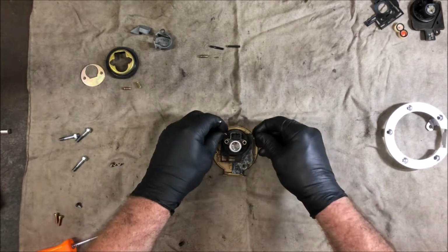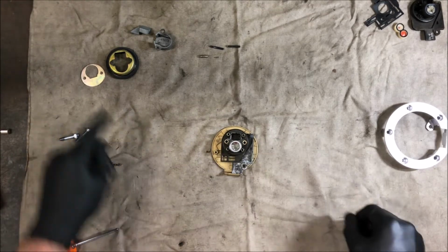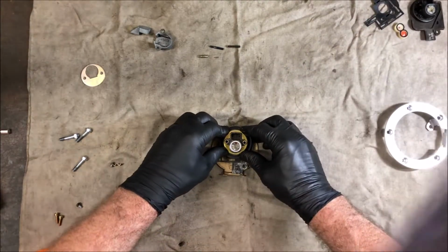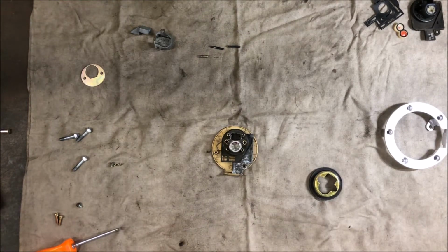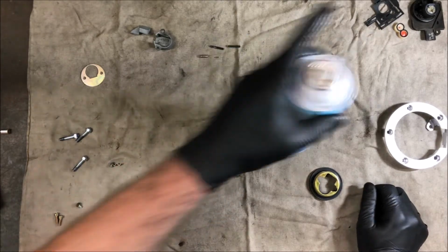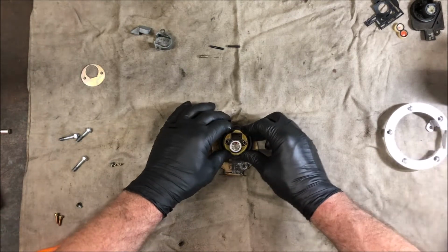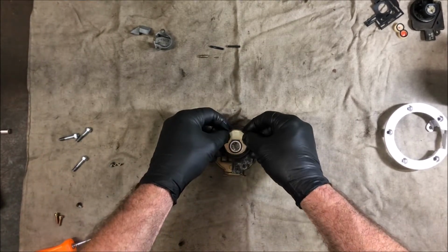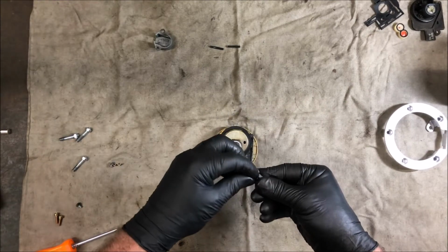And what preloads the cap is these 4 springs. So these 4 little springs go on the 4 posts. There. Then this is the tank seal. It sits on over that, and just make sure that it can slide up and down on the springs. Because some of these can rust up pretty bad over time, I'll just give it a little spray with the Inox lanolin, which is a nice lubricant, and the lanolin tends to stick around. Okay, so that goes on there. Then this plate goes on top to hold that, and the top of the lock mechanism is this bit.